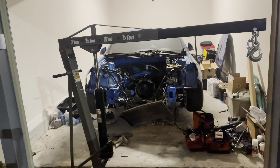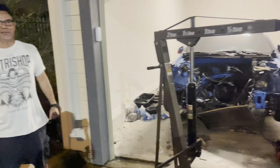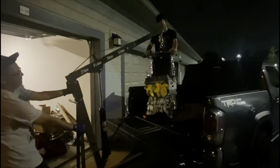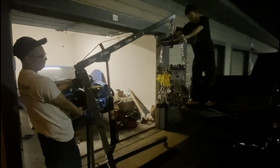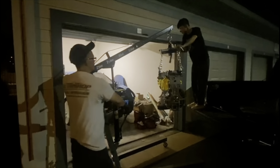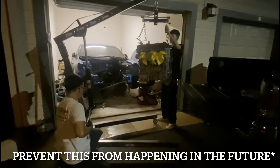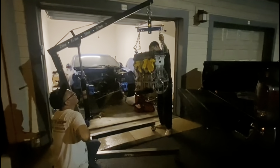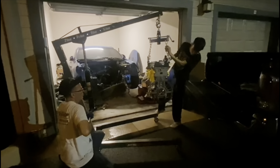Motor's back — thanks for helping me deliver the motor back to where it belongs. Quick voiceover: if you guys haven't been watching, the reason we pulled this motor was due to a lifted head. We had low compression in cylinder 1 and cylinder 4, we lifted the head and blew the head gasket. We ended up doing CSS work — cylinder support system — and 4B11T ARP head studs to prevent this from happening again. The motor should be all fine now, very healthy, and able to take a lot more boost.